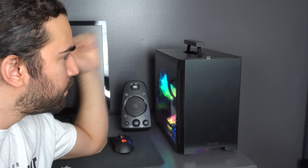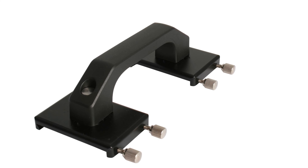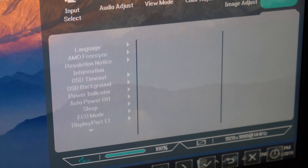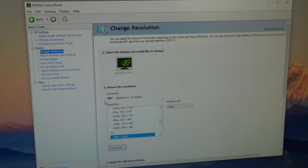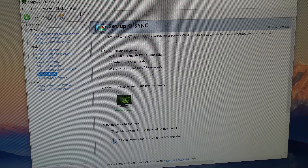This is the computer I'm going to be using — it's my personal rig, volunteering to run some games. I shouldn't have any issues running it at 144Hz; it's running an RTX 2080 Ti and an i9-9900K, and it even has a handle. For those who don't know, you can now enable G-Sync on FreeSync displays with newer Nvidia cards. To do so, first enable FreeSync on the monitor by going to Setup Menu, AMD FreeSync, then On. After that, go to the Nvidia Control Panel, Setup G-Sync, then click Enable G-Sync. Enable for windowed and full-screen mode is what I selected. Then make sure to click Enable Settings for the selected display model. Hit Apply and you're all set.